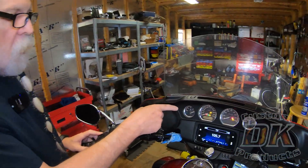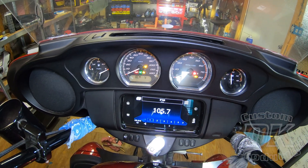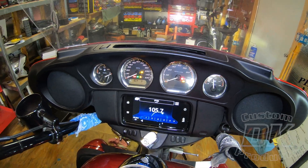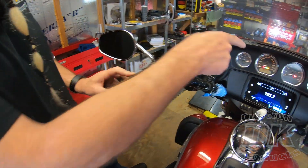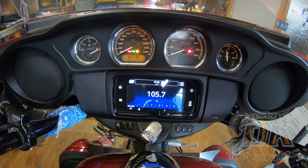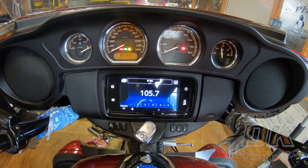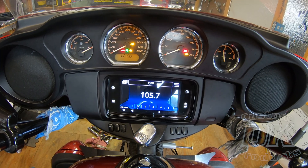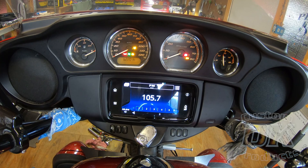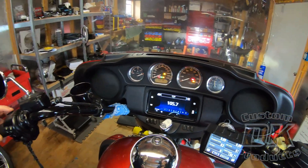But let's go back and you can just toggle through these. Let's go to the BCM — it says yes. And what you do when you want to see what the code is, you hold this button down right here until the code shows up on the screen. So we have a code B2116. And then I can toggle it and see if there's more: B2151, B2156, B2201. So I have all kinds of codes. We're going to talk about why I have so many codes shortly.